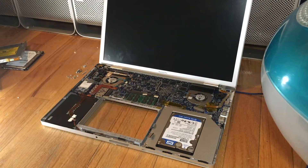Okay, there it is with everything installed. Hopefully it should all just work. What I'm going to do is reassemble this off camera because it's a pain to get it back together and get all the screws in perfectly. We'll see this on the very first boot up. Okay, it's time for the very first power up. We'll go into the boot menu to see what drives show up here. Let's hit the power button and hold the Option key.